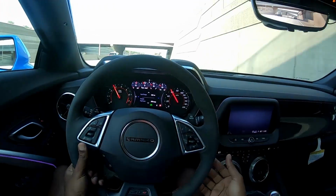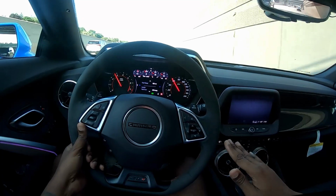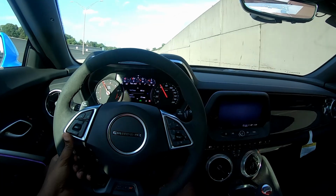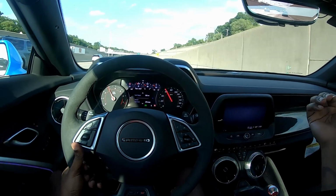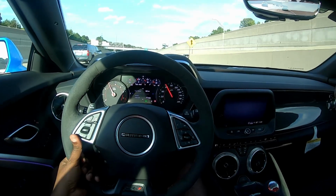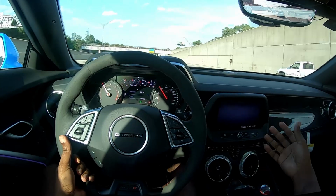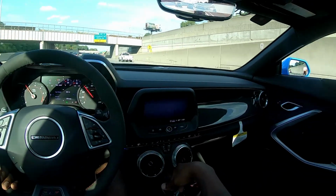Like this car, you can drive it normally, it'll pop. The GT350, you had to press the accelerator slightly on decel to where it still drops the RPMs. And on there, it was at like 4,000 RPM. So it was hard to do and easy driving. And this, I'm just cruising and it'll do it now. Now it's at 3,000. It's weak around 3,000, but 2,000 and 4,000 is where you want to be.